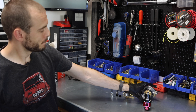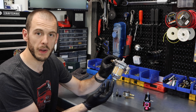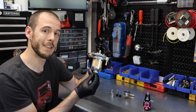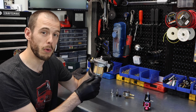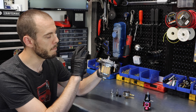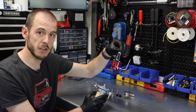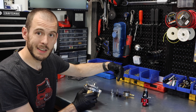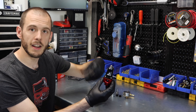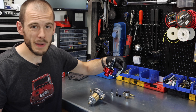One more thing — this really trick, cool fuel pressure regulator setup that I have here. Ordinarily this would be used to regulate pressure on a deadhead setup, but in my case I'm going to open up the pressure regulator basically all the way so it only serves as a filter. It's going to sit in the engine bay — I just think they look so cool. It'll give a good visual indication of fuel being delivered to the carburetor, but it will not regulate pressure at all. The Aeromotive regulator will be doing all the pressure regulation work. I'm actually going to be installing the Aeromotive in the boot of the car so everything can return directly to the tank easily, and it shouldn't have any problem maintaining pressure all the way up to the front of the car.